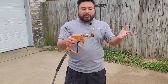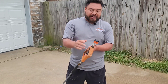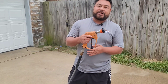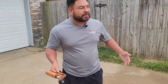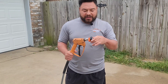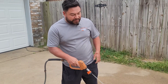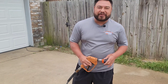I've really enjoyed this, guys, and I recommend it — it's really nice. I know some people like to use the rotary nozzle; I have that as well. What would be cool is if it came with the rotary nozzle included. But this is something really cool to showcase for those who are mobile or in a shop and you're tired of buying new tips every two months. With this, you have four different types of spray settings. Quick tip: if you're working on a dirty car, start at zero degree to get all that mud off, then switch to your 15 degree to get it nice and clean — it's a no-brainer.